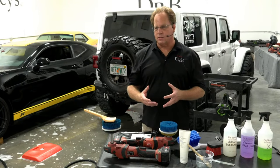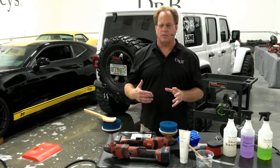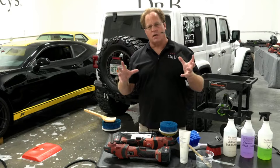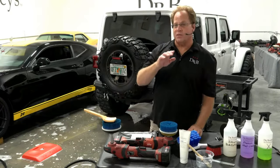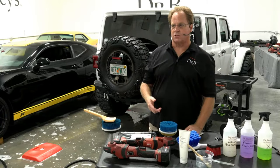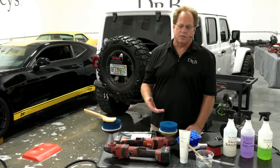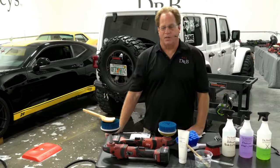Blooming technically is when tire manufacturers create the rubber, they add what's called anti-ozonant in it. It's meant to migrate to the outside of the tire, and it keeps the tire fresh so it doesn't dry rot and crack. But part of that is when it meets ozone in the air around it, it turns brown. So that's what the brown color is. It's actually a natural byproduct of the tire preserving itself. It's not a good thing, but it's part of the process. So the tire's bleeding. It's part of the chemistry of the tire. Yeah, the tire's bleeding.